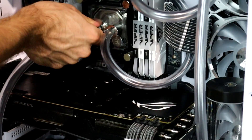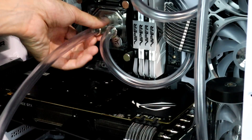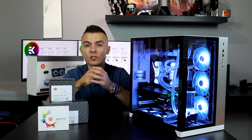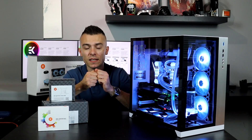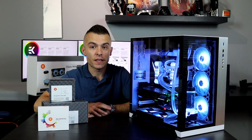When placing the soft tubing on the fittings, put a little bit of moisture on the end of the tube so it fits nicely into the fitting. After that, place the compression cap and screw it onto the base fitting — whether on the block, radiator, or pump — which creates a tight, secure hold so the tube won't come out of position.